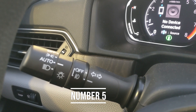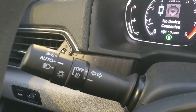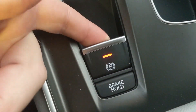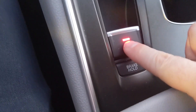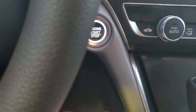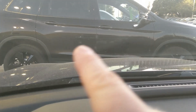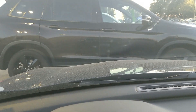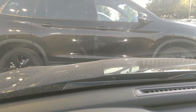Have you ever been sitting in your car at night, maybe just waiting for somebody, but you don't want your lights on? Make sure your parking brake is on and set, then turn your lights off. You'll notice in the reflection of the car in front of me my daytime running lights are still on. With the emergency brake set and lights off, go ahead and turn the car off. Now start the car back up — you can have the AC running and music going, and the daytime running lights won't kick on until you turn your emergency brake off.